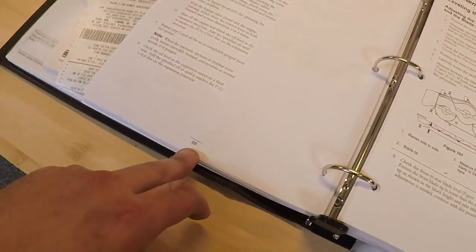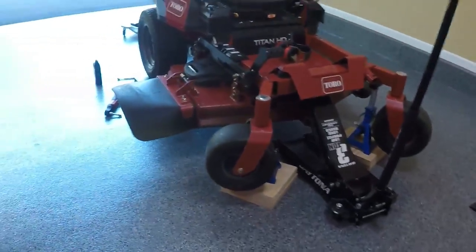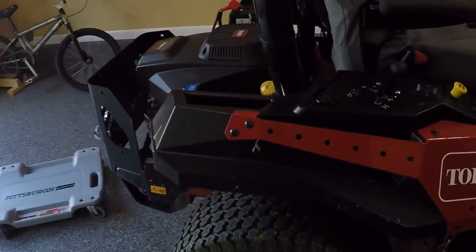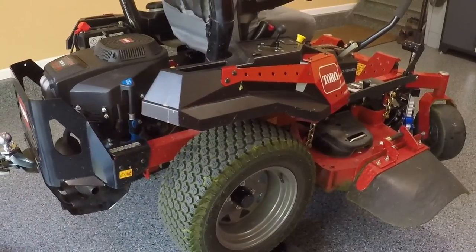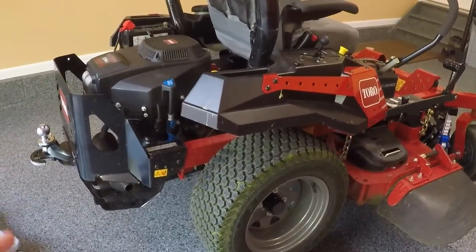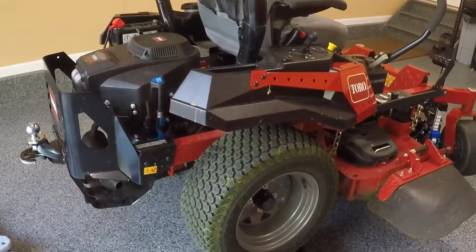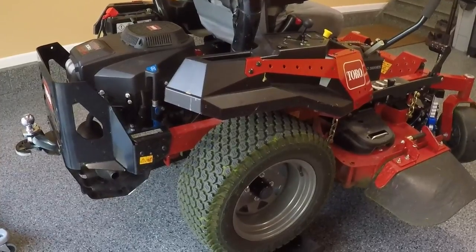Pretty simple. Just make sure your level is topped off to at least the full cold level so you don't accidentally suck air into the mower and have to start all over again. That's basically the bleed procedure. Again, it's in the Toro manual — for the Titan HD, page 68 is the bleeding procedure. That's a standard procedure whether you check the video from Hydrogear or go by the Toro manual. I'll put a link in the description to Hydrogear's video on how to change the fluid and bleed the system. A pretty informative video — it basically covers exactly what I just did. I hope you enjoyed the video, thanks for watching.